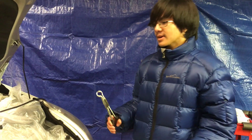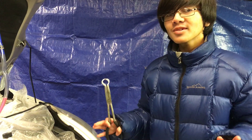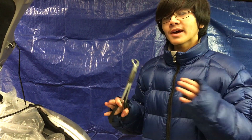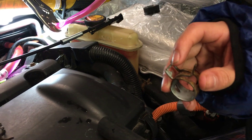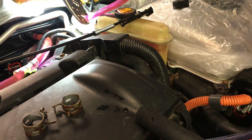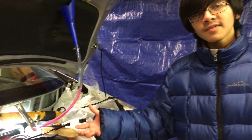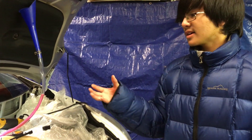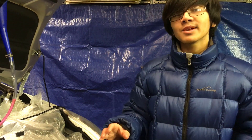I think we're done. Before I go, I want to talk about the hoses themselves. We didn't actually show you how to take out the hoses, and taking them out is very tricky — same thing with putting them back in. With taking out the hoses, it's very tricky to take out these clamps, especially because for us it was actually bent, and we had to end up breaking it in order to take it out. We tried using this flexible tool for taking out clamps, but it was a bit tricky as well. When you're actually wiggling out the hose itself, you don't want to use your hands — you're going to end up breaking the neck of the heater core, which means replacing the entire heater core. So you want to use hose pliers: just grip around the hose where the neck is and slowly and gently take it out.